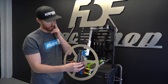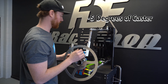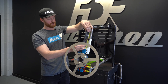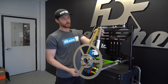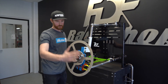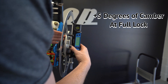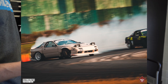With this setup we have negative eight degrees of camber, five degrees of caster, and to get a rough idea of our KPI — even though this is the variable that's changing — our rough KPI angle is 14 degrees through our two ball joints, giving us our kingpin inclination axis. That is the axis this whole setup rotates on. Now let's turn the wheel to full lock and measure what we're at — this is actually a positive five degree angle on our wheel at full lock.